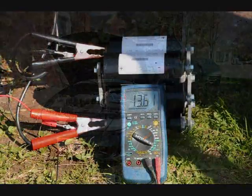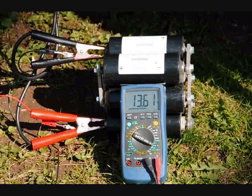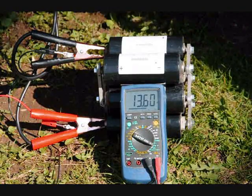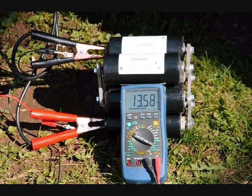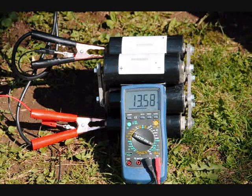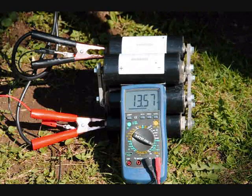When I started it, the charge was about 12.5 volts or so. The alternator kicked in and boosted it up to, as you can see, 13.6 volts. But if I left this plugged in overnight, the charge would start to deplete slowly — parasitic loads like the computer and the clock would bring the volts down past 12 volts. We need to be at 12 volts.